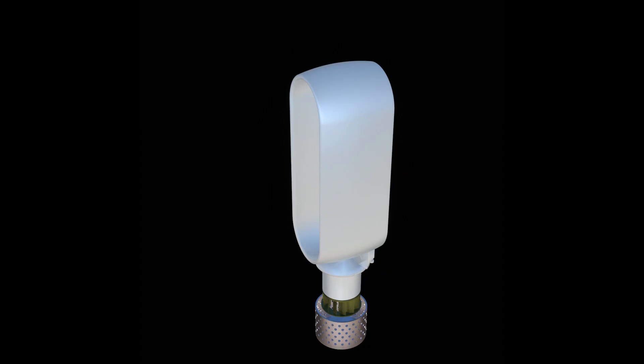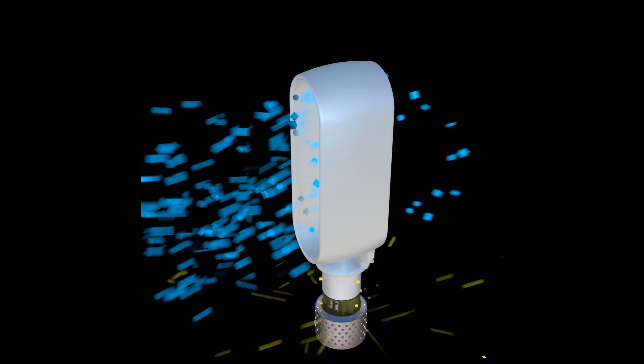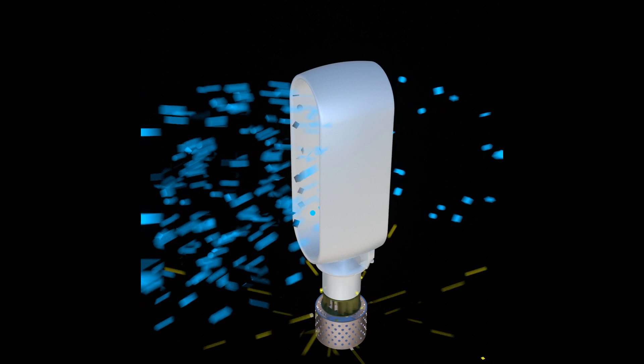With that in mind, when the fan starts to rotate it sucks in air from the bottom case, and this air goes up through the side of the motor housing into the hole at the base of the upper part. The air is then forced out through the ring of slits around the fan, but this airflow alone cannot be sufficient.